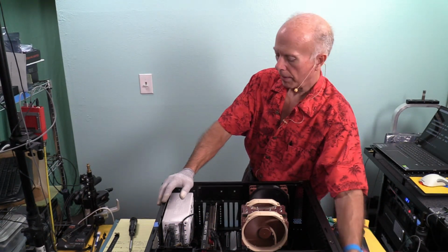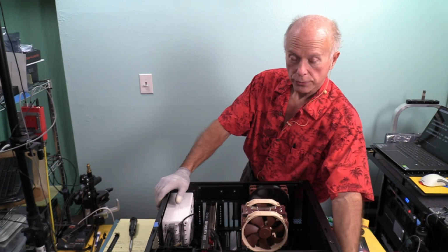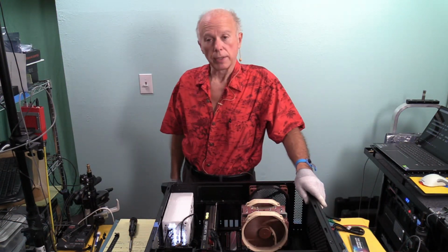I'm going to shut it off. Okay, I'm going to drain the power, turn off the power supply. A cold boot is very essential sometimes when trying to diagnose a computer. Power supply is back on. Power button. We'll see if it'll post a little faster this time.